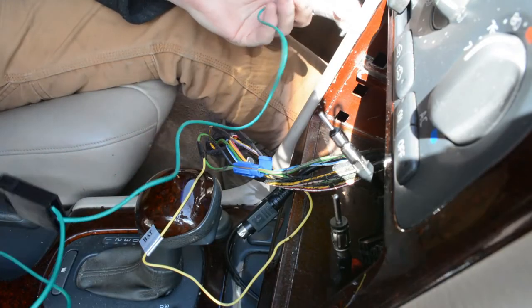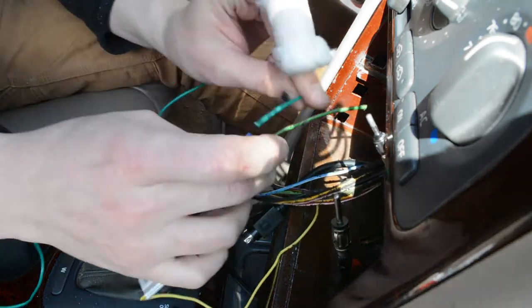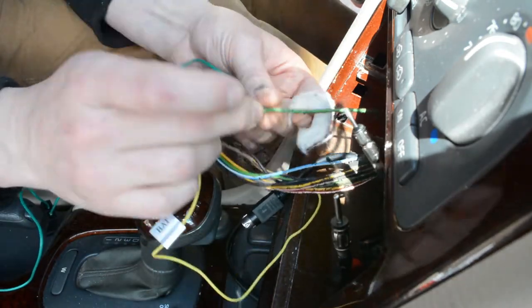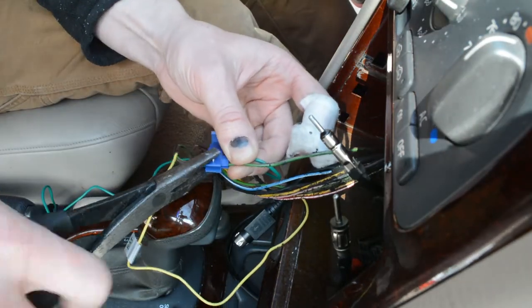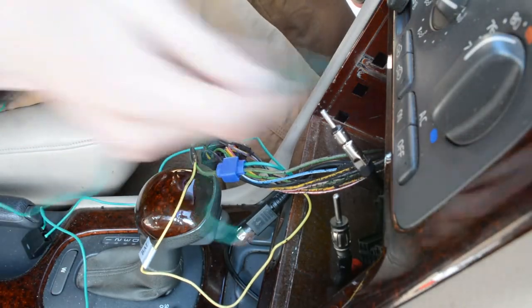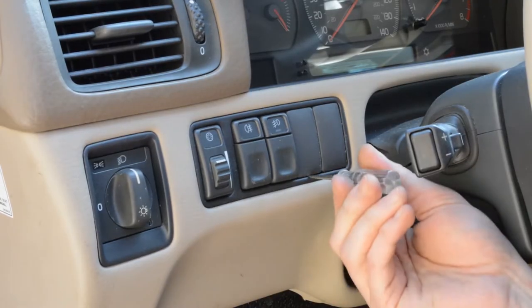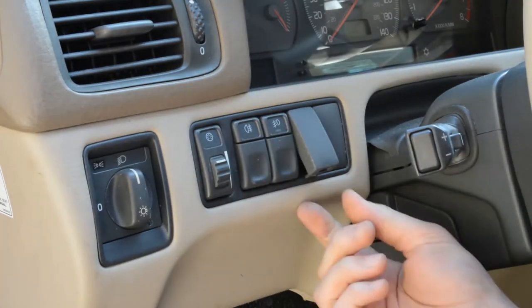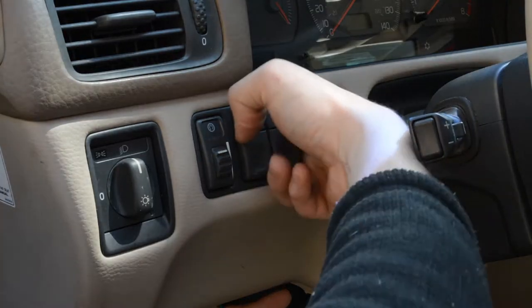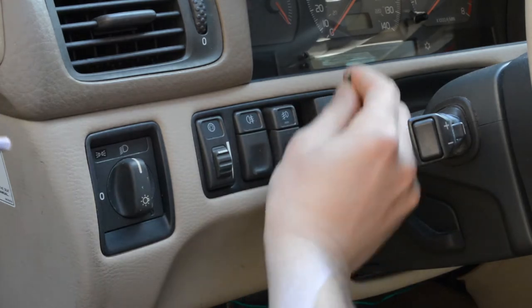I had a snap connector left over from when I bought the Grom unit so I just decided to use that for the fog lights. These are really simple to use — you just slip your existing wire through one slot, your new wire through another slot, and then crimp it all together. Once you're happy with the connection, stuff all the wiring into the dash and route it over to where your switch is going to be mounted. Using a small screwdriver or pick tool it's real easy to pop the switch blank out, then feed the wire up through.